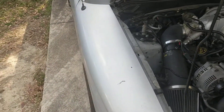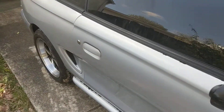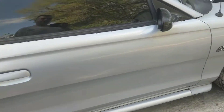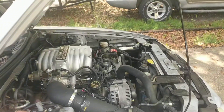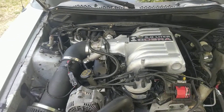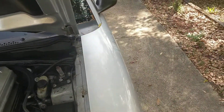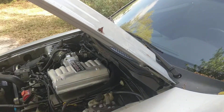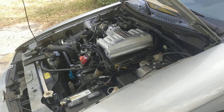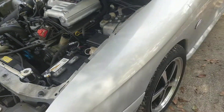Maybe get it up to the track once or twice. I can only run drag radials because he's got Cobra brakes on it and we don't have the stainless steel brake lines with the short banjo bolts, so we can't run the 15x10 slicks. The old Cobra ran an 8.2, 8.4, 8.5 somewhere in there on the drag radials, so this should do a little better. Anyway, showing you what this thing is about.